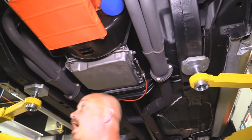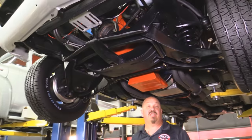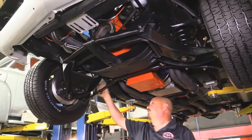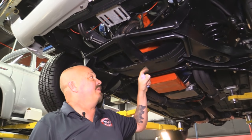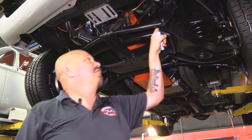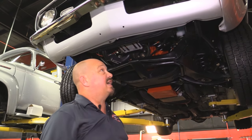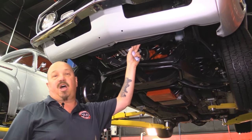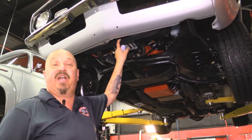Turbo 350 trans. Drum brakes out back — the guys will take the drums all apart and make sure everything looks good inside. Disc brakes up front and all this looks new — backing plates, ball joints look new, flex lines are new. The guys will check out all the steering gear. Front cross member looks great. These Camaros, a lot of times these things rotted out and fill up with junk — this one's nice and clean inside and she looks awesome. Looks like she's had new lower control arm bushings. The front frame horns are nice and straight. Front bumper looks new. Front valance has got nice paint and core support also. I always look at this core support — it's thin metal, first thing to go on a lot of these cars. This one looks brand spanking new.